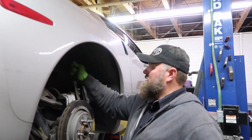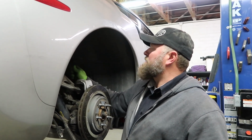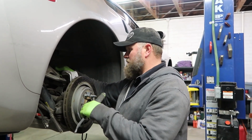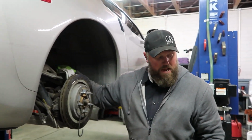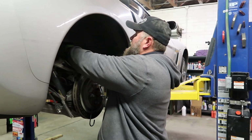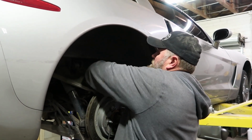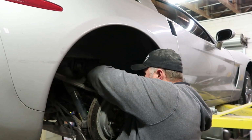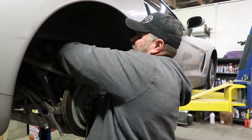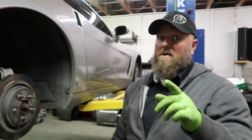So I mean, yeah, this is like the, I don't know, 10th or 15th Corvette you've worked on? This car's a repeat car. I did the exhaust and the headers on this car months ago, and we talked about what we were going to do with this car later on down the road, and well, now is later on down the road. Right, right. So today, right now, it's just going to be the oil pump, the harmonic balancer, new timing set, and cam, trunnion upgrade, trunnion fix, I wouldn't call it an upgrade, so the trunnion bearings won't fall out and end up in the oil pan, like the black car with the broken diff.